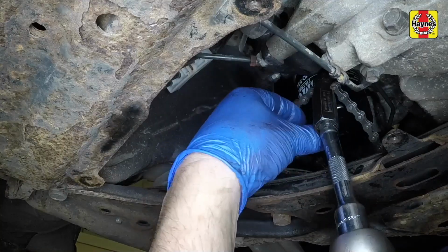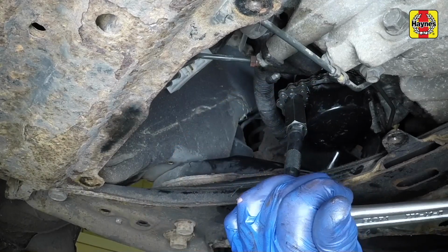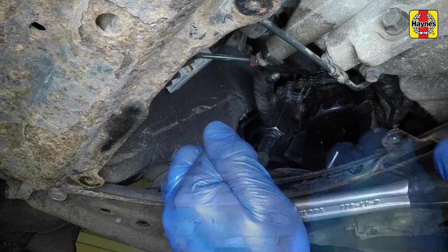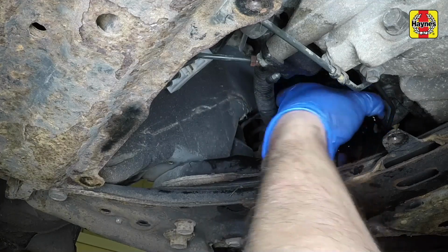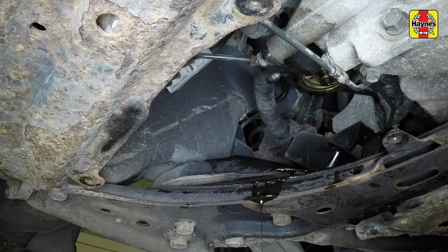The oil filter is located on the left-hand side of the engine, viewed from the driver's seat. Using a 76mm oil filter removal socket, chain wrench or strap wrench, slacken the filter initially, then unscrew it by hand the rest of the way. Empty the oil in the old filter into the container.